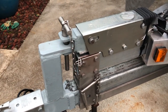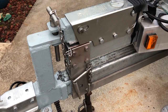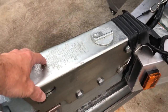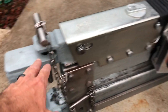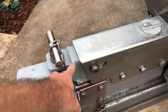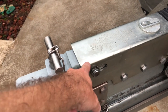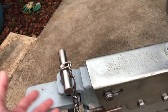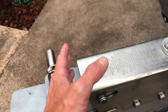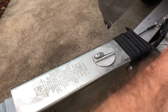The reason why this thing looks kind of complicated is because I have brakes. This trailer has hydraulic brakes — I have disc brakes. The brake mechanism here on the top: originally on my trailer that was down on the regular tongue, but they put it up on top. They have a sort of metal piece that's welded and attached to the brake mechanism where the actuator is. It acts like regular surge brakes — when your vehicle starts to come to a stop, it starts applying pressure against the spring or the actuator, which then pumps the fluid back out to the brakes.